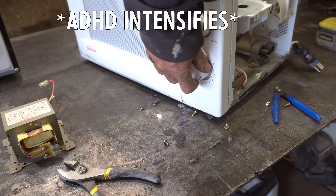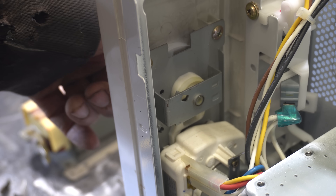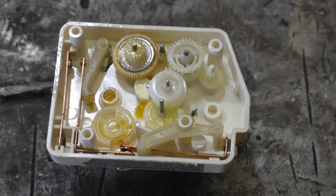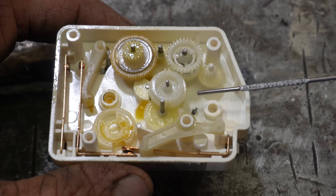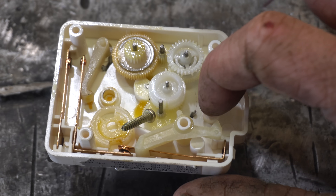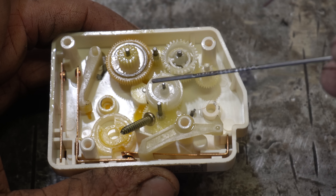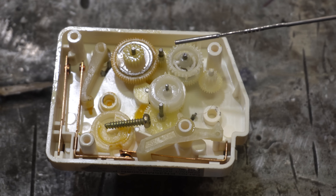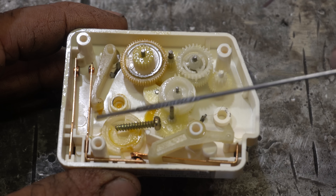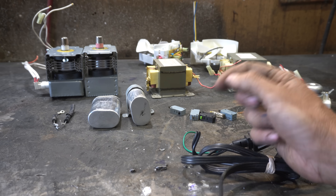Check this out — it's like a nice little bike bell. The top knob to pick the power has some funky mechanics going on. The power knob just moves this rack up and down, and it's input onto a gear that changes the gearing on the timer to make it go longer or shorter for higher or lower power. I love me a good workaround. My squirrel brain actually kind of helped me out here because I wouldn't have opened this otherwise — these contacts are gonna be useful. And here we have two microwaves minus all the stuff I don't want.